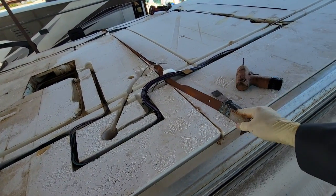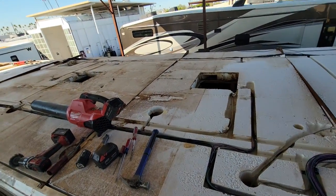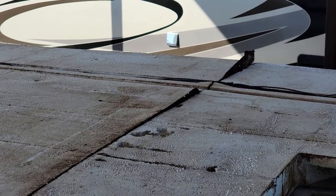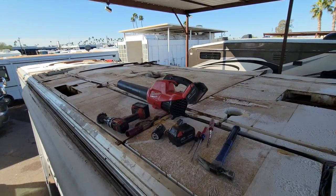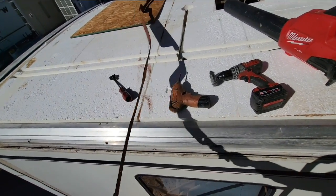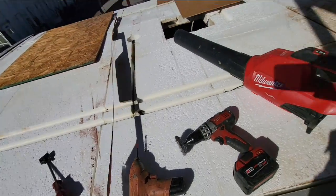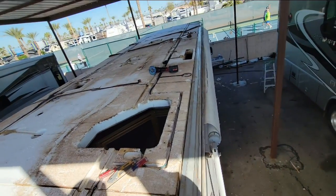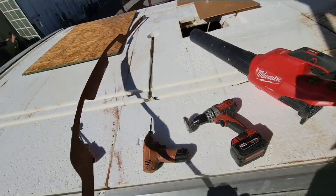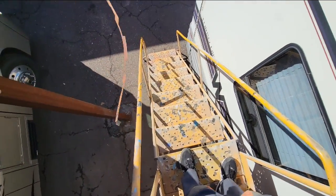Because it's deformed, once I go to laminate this, it will actually be pushing up on the substrate, so I have to get rid of the ones that are really bad. You can see how rusted and thin it is — gotta get that out of the way too, because this area right there is very collapsed and deformed. There's absolutely no strength to this thing at all. It's notched out right there because that's where the AC ducts are, and that's why there's a big crack down the middle — because when the roof gave out, that AC duct is that thick of styrofoam and it doesn't support any weight.